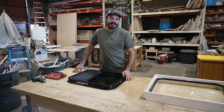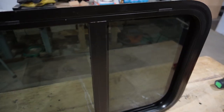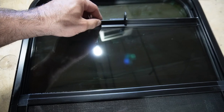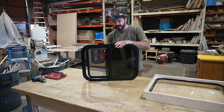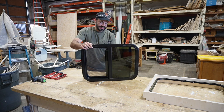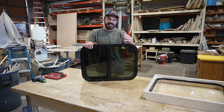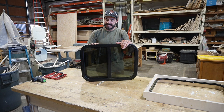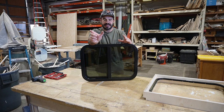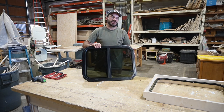Now that I've showed you my thoughts on bus windows, let's take a look at what we're gonna be replacing them with. This is one of the windows that's actually gonna be going in my bus, and it is a dual-pane sliding RV window, and it also has a latch and a built-in screen. The screen is obviously a nice feature — stock bus windows don't have a screen — and the screen slides out of the way, so you can hand cups of coffee through the window or whatever. Most RV windows are designed for wall systems that are not as thick or as insulated as the wall systems we'll be installing in our bus. I believe the biggest thickness these windows can be designed for is about two inches, and my wall, when it's all said and done, is going to be a total thickness of just under four inches. So we have to get around that by making a special frame for the window.